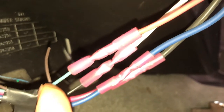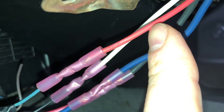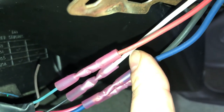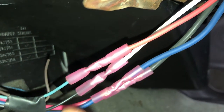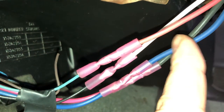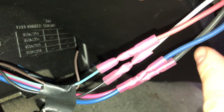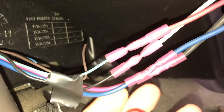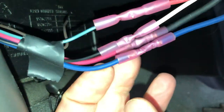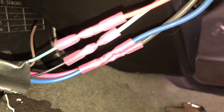To make the connections, I went from the blue on the factory trailer brake harness to the red wire on the trailer brake controller. Then the black one — the blue goes to blue on the trailer brake controller, and the black wire goes to the red wire in the factory harness. It was real simple to hook it all up.